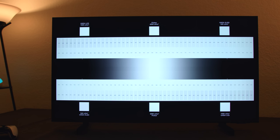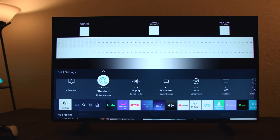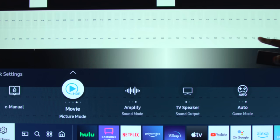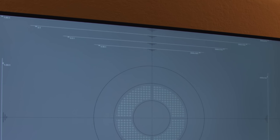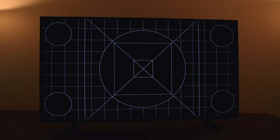Here's an example of a contrast test. On this bottom line you can barely make it out, which tells me it doesn't really have great contrast when it comes to some of the different gray scales. If you go into your settings you can go to the different picture modes — so that's natural; still that bottom line is not showing up that well. We can go into movie mode where I can see a little bit more, but it made the picture a warmer color. Then there's film mode where I can see a little more, and back to dynamic where again you can't make it out that well. This next test shows how well they aligned the TV set when they built it, and I would say Samsung did a really good job on this — in fact that's more like the 4K line right there. Everything seems to line up very well, so whatever you see on this TV set is going to be more accurate than, for example, the 6-series I did from TCL. Really good job, Samsung.